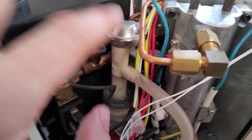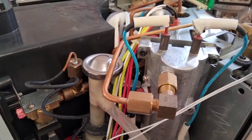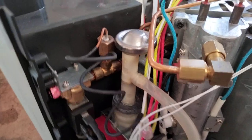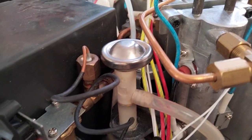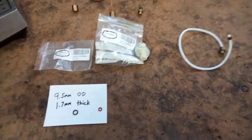In this one the suppression unit is off a DeLonghi machine; on the other one it was from an EM7000 Sunbeam. They're the same thing — there are several other companies who make them, they all achieve the same purpose. It's basically about fitment and how it's going to fit in this area. This one is actually really nice — it's tight but it fits in there, probably fits better than the old Sunbeam one actually.